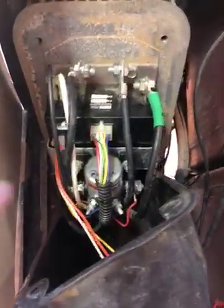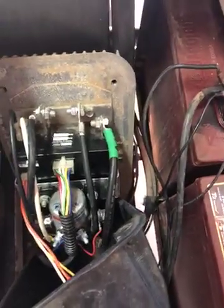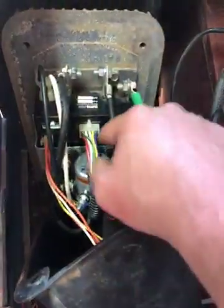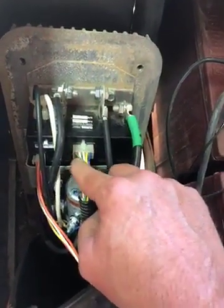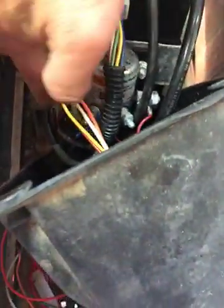If you can see here, this box right there — it's a Curtis 1206MX. It's a 350-amp controller. I got to testing this and I'll put the link to all the different diagnostic tests you can do to check the wires and pins in the description of this video. One thing I figured out when I had my cart on jack stands was there's a four-pin connector right here.